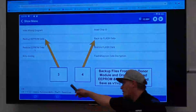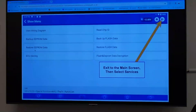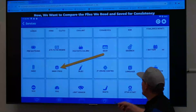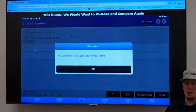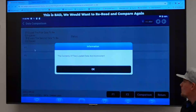You initiate the connection, back up the data two or three times for each of the two file styles on this ECM. Then we go back to the main screen to the file comparator — most cloning guys were asking where the hell the file comparator was, and they've now added it back to the tool. We go into services and ImmoProg, hit data comparison, load the multiple files, and hit compare. If we might have had a corrupted read, go back and reread that file another time, then compare all three. Whichever two are the same, you're pretty confident.